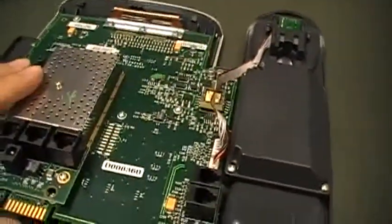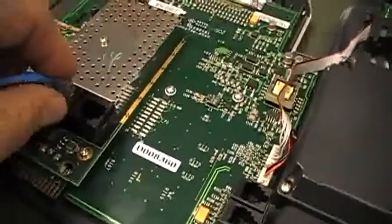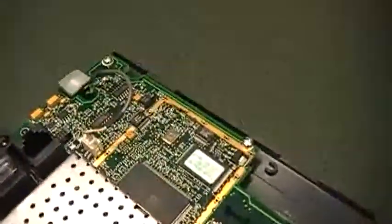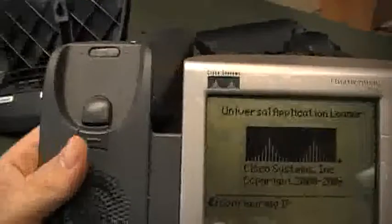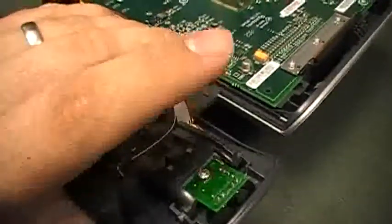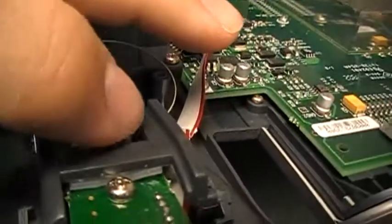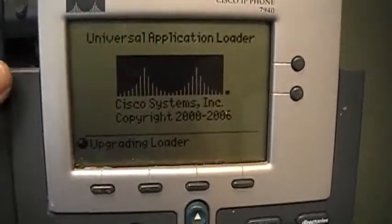What I would do before you put the whole thing back together is test it out. Take your plug and go ahead and plug it into the switch. If you require power, there's your power. After plugging it in, when the lights pop up it should display and work as normal. Once your phone comes up, keep your hands behind the assembly so it doesn't come flying apart. Push in the trigger and pull it back up to see if the line comes up as normal. Push here to hang up the phone and then release it, letting the spring come back without pushing on the back. If the line comes up normally, you should be good to go.